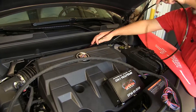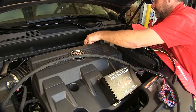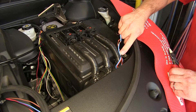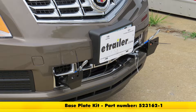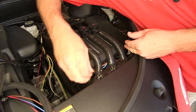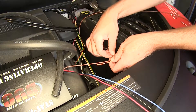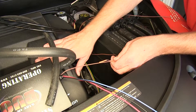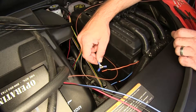Now we'll move to the top of the engine compartment, take our air line and wiring, and pull it up into place. Now that we've got everything routed into the engine compartment, we can start making the connections here. We have two wires that are zip-tied here to the top of the battery — these are the two for the breakaway switch that were previously installed with our Roadmaster base plate kit, part number 523162-1. We'll go ahead and cut them free and route them to the other side of the battery. We'll connect these two together, take the orange wire with a black stripe, connect it to the brown wire coming from the operating unit, and then the remaining portion of the brown wire will get routed to our positive battery post. Keep in mind that anything secured to the top of the engine will need to have some wiggle room as the engine will move while it's running. To make this three-way connection, we'll use the three-way butt connector provided with our install kit.